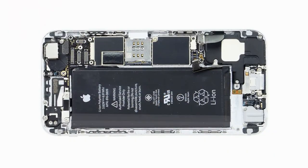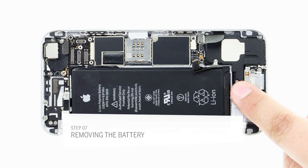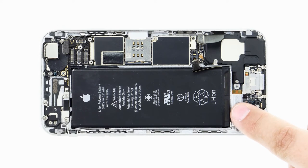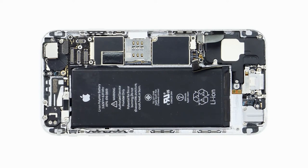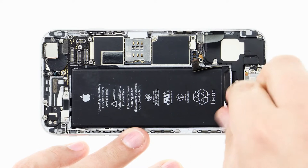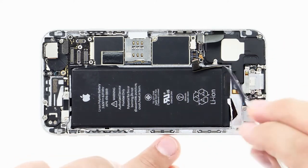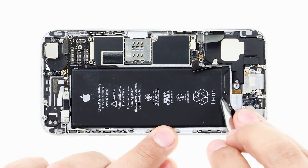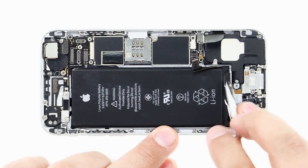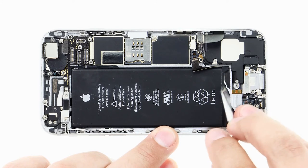There are 2 adhesive strips holding the battery in the enclosure. The 2 ends of the adhesive strips are stuck to the top of the battery. Use the steel spatula to detach them. Using the steel spatula, carefully try to detach the adhesive strips. Doesn't always look that great, but it works well. Be very careful so you don't stick the steel spatula into the battery.